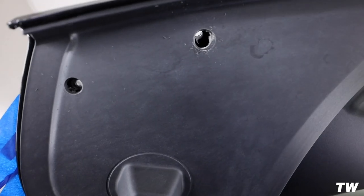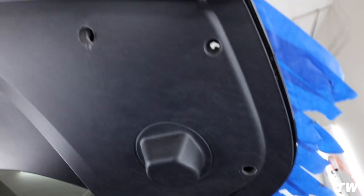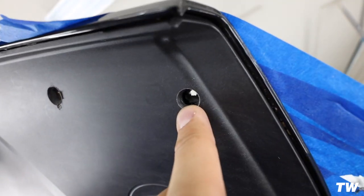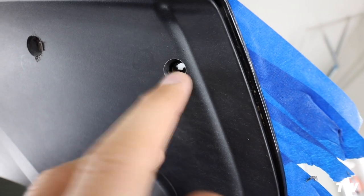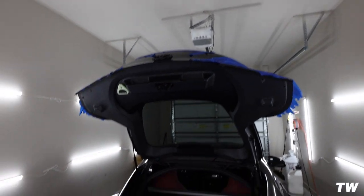Got these opened up — I think that's going to do the trick. It might be a little tough to fit a washer in there; I might have to go even wider on these holes. You just want to be careful because you really don't have much room — it's millimeters until you hit the trunk, and you obviously don't want to widen out the hole in the trunk. I'm going to do a little bit of vacuuming here, clean some of this stuff up, and then pull the tape off up top and start mounting these end plates.